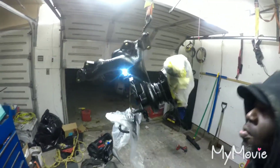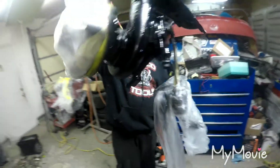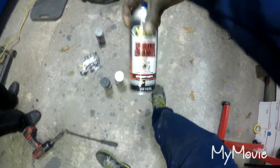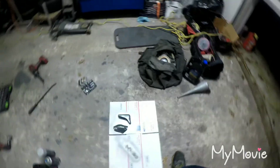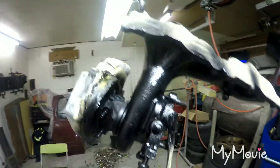Going on in flat black - I sanded it down and cleaned up all the rust spots and covered up all the corroded stuff. You can see this is a flat black - everything's covered up, it's getting nice and pretty. One can I got is wrinkle paint - oops, that's for 500 degrees plus, so it'll be alright with the flat black. We got the first coat of flat black on the manifold and turbo. It's dry to the touch - we're gonna throw another coat on there.